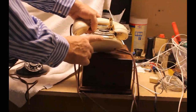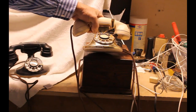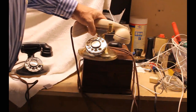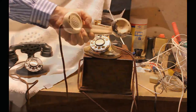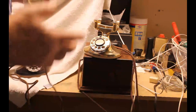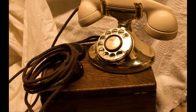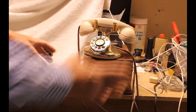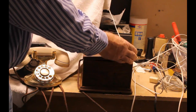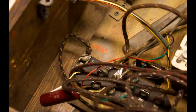It does have some chips on the phone — a chip on the front where the plating is coming off. It is not gold plated, not 24-carat gold plated. It's a brass plate and they sprayed it with a gold lacquer — that's how the Imperial set was done. They also came with an F1 handset. This one is a little chewed up, sorry. This phone I'm selling to somebody who wants to start a phone collection, who thinks antique telephones are great. It's got a 4-foot cloth handset cord on it, and it's got a 9-foot line cord that goes to the wood subset. The wood subset is not an original subset — it is one that I put together: a 533A LEICH magneto set with no magneto in it, and I placed a 685A network in it.